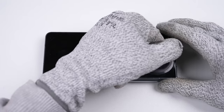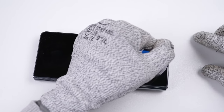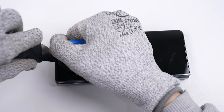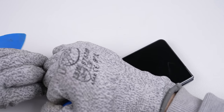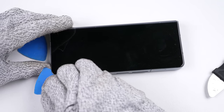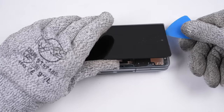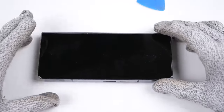There's still one half to go. I'm under the assumption this display still works, so I need to be careful when removing it and keep it intact. Unlike the back glass, its adhesive appears to be unaffected by heat — just like the Pixel 7a I took apart recently. This display is using the same method of attachment; some comments suggest a heat-resistant gasket similar to what they may use in car engines. The only point of entry was through the earpiece, carefully sliding my metal tool under and along the top edge of the screen. Once I had an opening, it was back to the plastic picks. Once I had three sides free, I thought I'd just be able to slowly fold open the screen to release the last side, however this adhesive is so strong I thought I might crack the glass, so I continued prying using the pick.